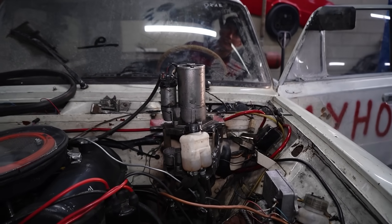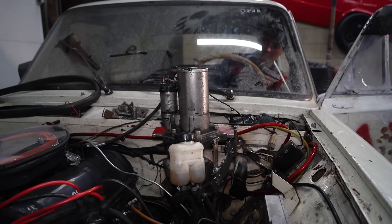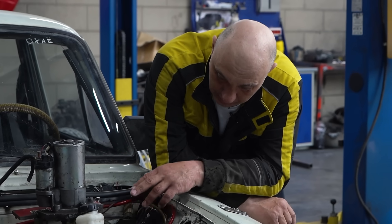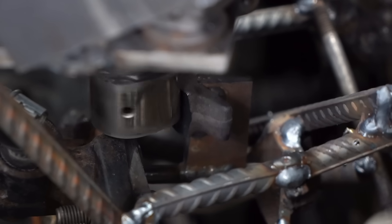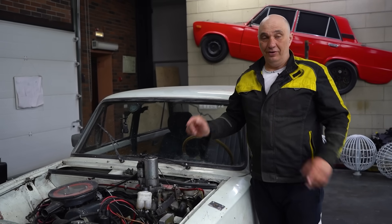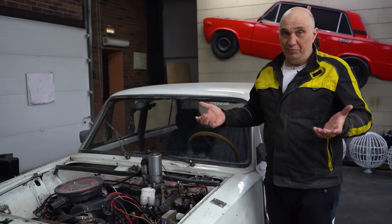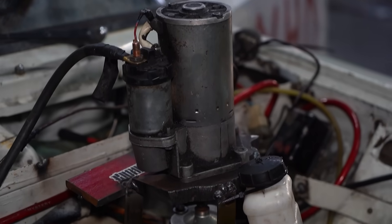Now the mechanism itself is very straightforward. We have a starter motor, we have the second reduction gear which reduces the rotational speed. We've slightly moved the brake cylinder forward, welded a support onto the rod, and a cam lobe to the reduction gear. That will be temporarily knocking the brake pedal back, slightly reducing the pressure inside the brake system. The pads will loosen their grip and allow the wheel to rotate. So as you can see, it's pretty much like your normal ABS — just very ghetto and simplistic.